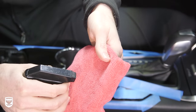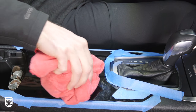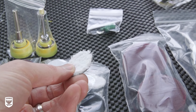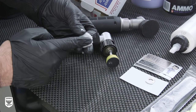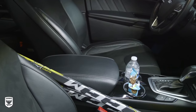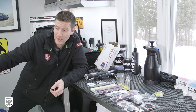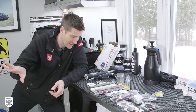Next, use a mixture of 50-50 water to isopropyl alcohol to clean off hand grease, sports drinks, coffee, etc., to avoid contaminating our very tiny tools. Residue control is even more important here with tiny surface areas and tiny pads than it is with larger pads and bigger machines. The interior trim is taped and we've cleaned it off. There's going to be a ton of oil and coffee or whatever else, and we don't want to fight residue control — which is a big issue with paint — and we're going to have the same exact thing on the inside, but with even more oils to deal with.